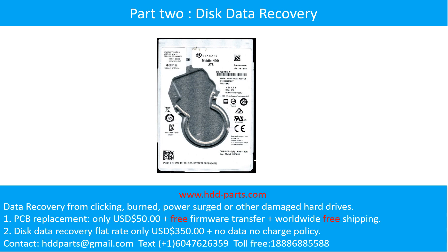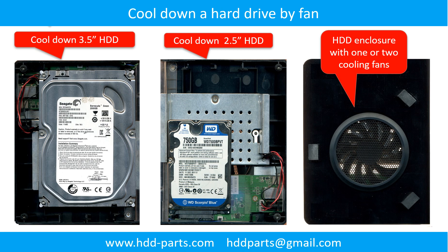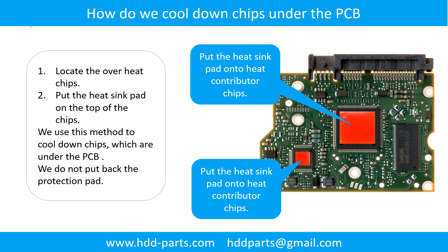Part 2: Disk data recovery. There are some simple ways to recover data from a hard drive. One of them is to try reading the hard drive with different devices, like different external hard drive adapters, computers, or enclosures, because different devices use different ways to read a hard drive — sometimes this trick works. Another way is swapping the hard drive PCB board, which can fix the problem caused by the PCB board. There is a cost in swapping the PCB board, but it is way cheaper than sending the hard drive to a data recovery firm. This picture shows how to use a fan to cool down the hard drive, and how to cool down the overheated chips which are under the PCB board.